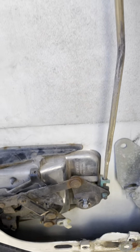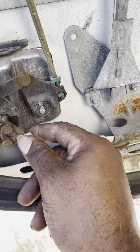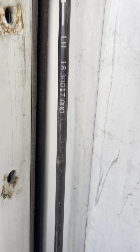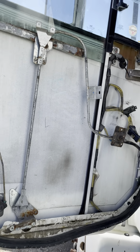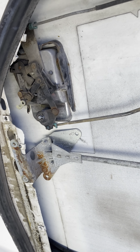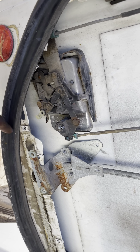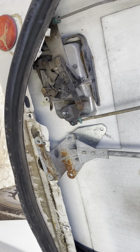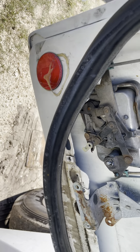This is your lock — this rod. This is where your door open would go, and this is the mechanism for your door open. So this is the inside of a Freightliner Century Class door. That's how it looks — all the actions down here. So like I say, if you ever want to re-key it, you're going to have to pull the panel off to get in here and re-key this door. Good luck.